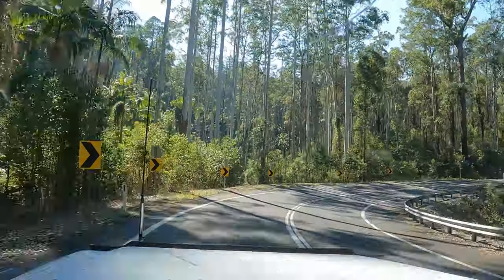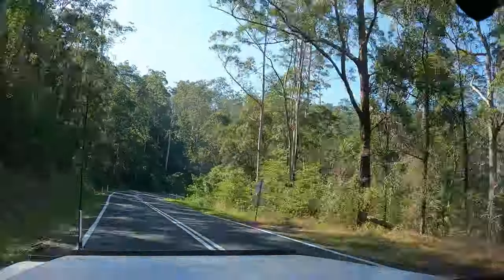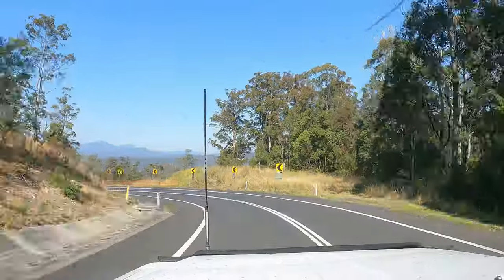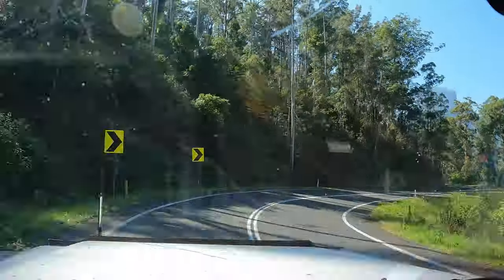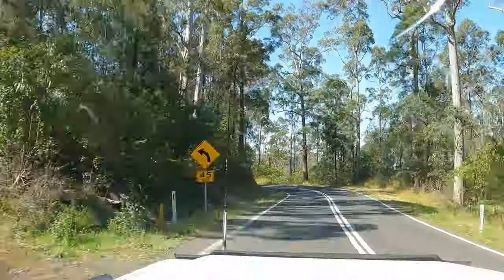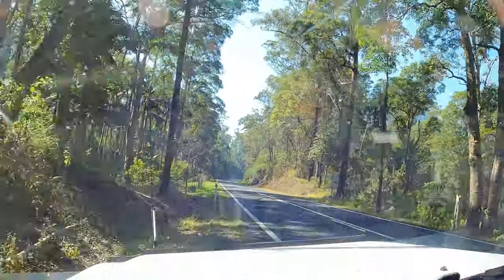So yeah, really happy with the airbags. Performed really well all weekend. Felt really soft driving forward because we dropped them down to 5 PSI. Back on the bitumen heading home, mountain pass, very windy, got them on 30 psi, and the car is stiff, handles really well. And Joe's a testament to that because he's now car sick.